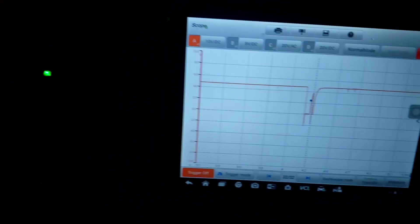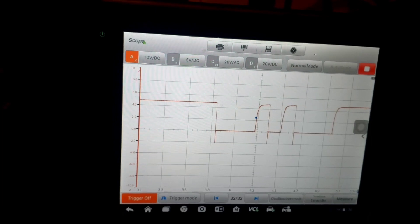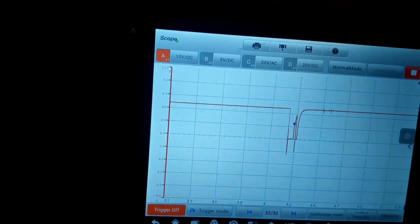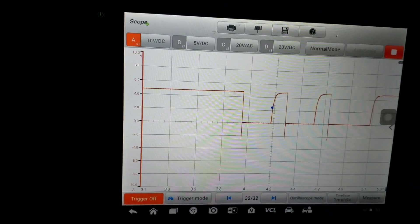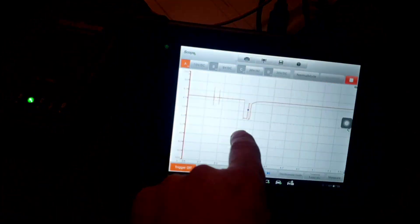We're communicating now. We're going to have him cut the wire when I tell him — go ahead and cut it. Look, our check engine light came back on. Our bus signal looks the same though — that didn't change anything — but our check engine light came back on. So we cut that signal ground and now we're going to chassis ground, just bypassing the computer's sensor ground. We still have key-on engine-off and we still have our light. Check engine light is on — which is good. When I crank it, there's your SCI waveform still, but no crank signal at all.